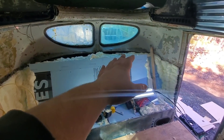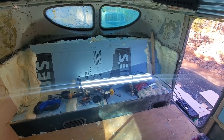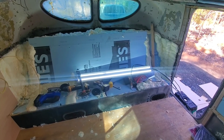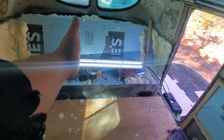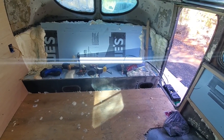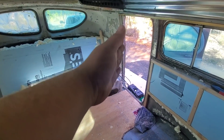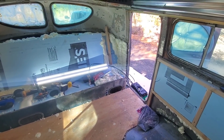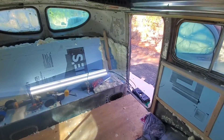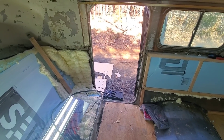We've still got a lot of stuff to do back here. I re-spray-foamed this this morning and sealed up the rest of it. My engine access is that piece there, so I made the sheet metal panel to get to it — put the foam back over it, did not spray foam that in, so it's still removable and we can still get in there. The way I'm doing my bed frame, I'm splitting the frame in half — so half of it will be this side over, built in and screwed down, and this side's going to be free-floating. If I have to work on the bus, I can get the mattress out of the way, flip this half of the frame over, and I can still get in there. That leaves me good access to come in my rear access door if I need to get larger stuff in and out — the bed's going to go halfway up that thing. The fact that that door works on this bus, I'm so happy — it's made it a lot easier to get materials through.